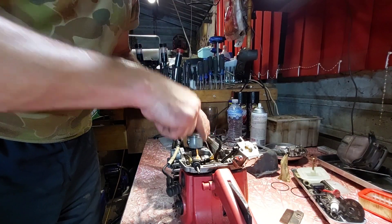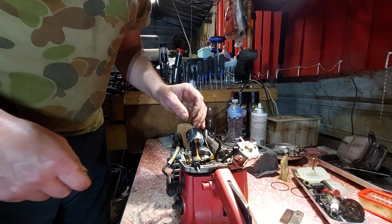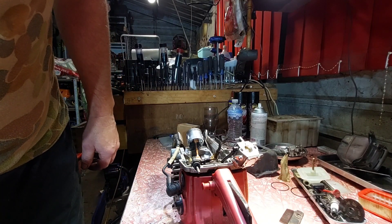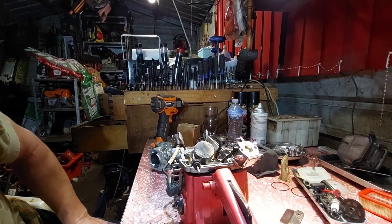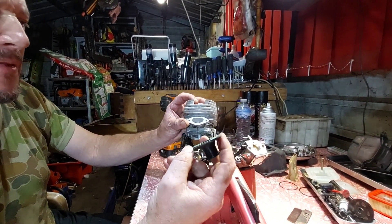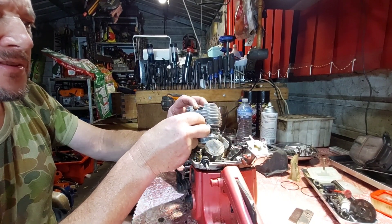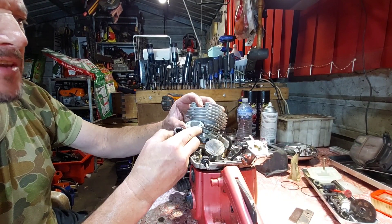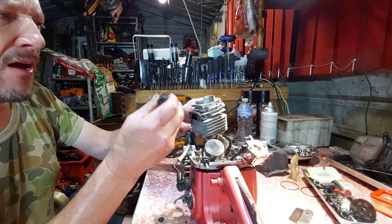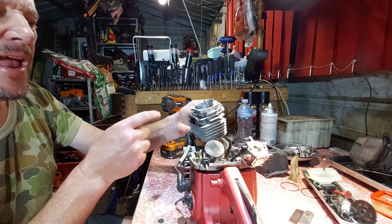Interesting. I wonder why. I'll clean it up and get the cylinder back on so I can do the degree wheel. I thought I'd also pull off the intake boots so I can actually see the intake when I'm doing the degree wheel, because they are small. That'll make it easy for me to see exactly what's going on. Even though the intake on these are curved, I know how much intake these normally have.